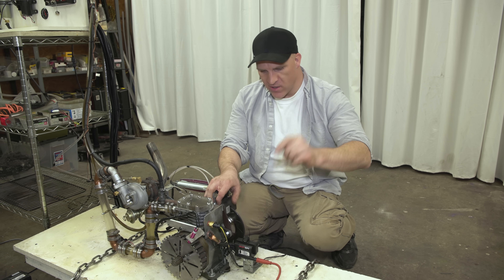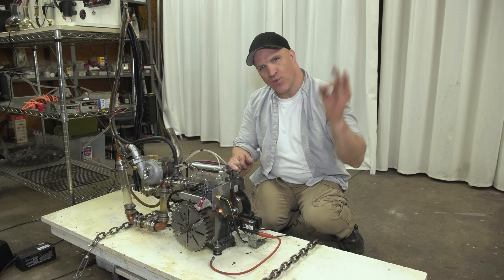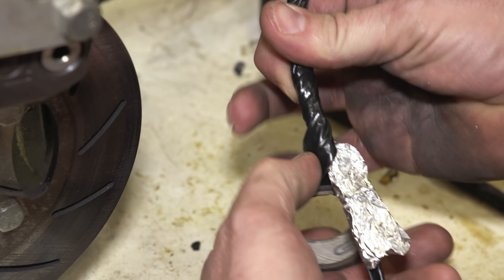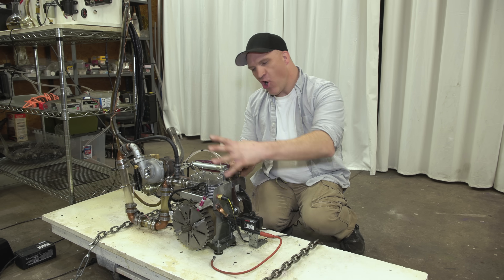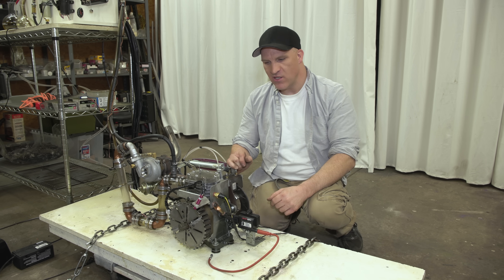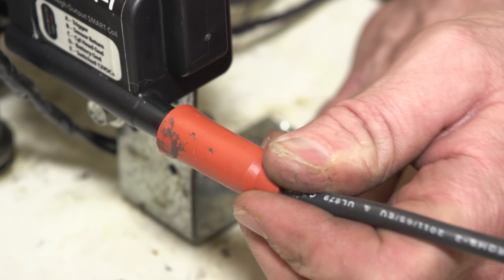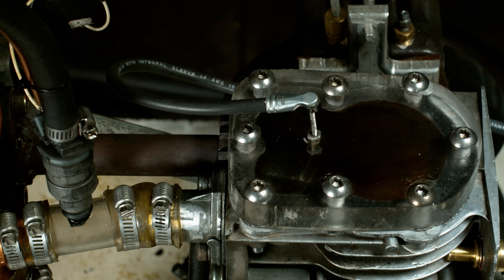The first thing I changed was connecting a large ground cable from the engine block directly to the negative terminal on the battery. I shielded the entire cable to the crankshaft position sensor. Then I took all the ground wires from the sensors and connected them to the sensor ground that goes straight to the ECU. Last but not least, I rerouted the ignition cable behind so we can get a nice clear view inside the combustion chamber for the entire run.